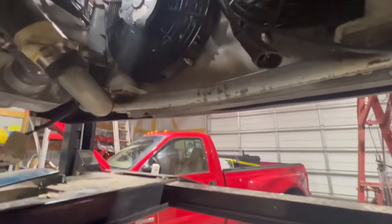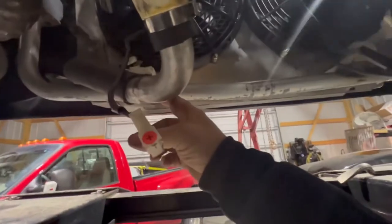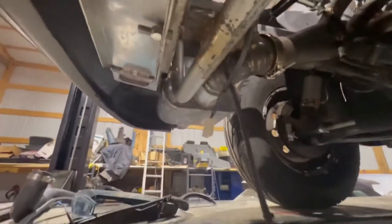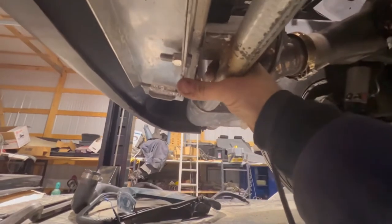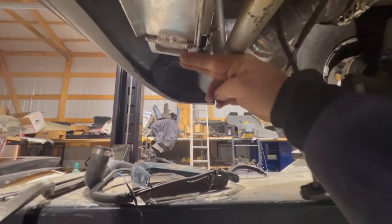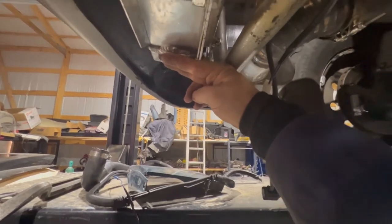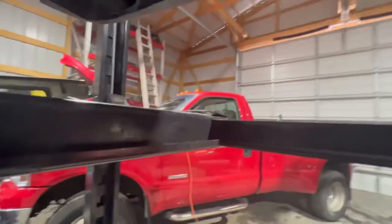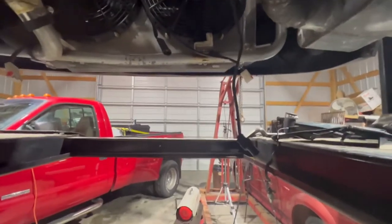Here's what the radiator looks like sitting in here. Looks like the same hose is going to work, but there's not enough room up here for the overflow, so I have to mount that somewhere else. This bracket here is up against the fan — that's what's holding it from falling through — and the pressure from this bumper. I need to figure out a way to bring something off of here and over, probably right here where this mount is, and weld it in so it'll support right there on both sides. Then the bottom should be good if I do that.